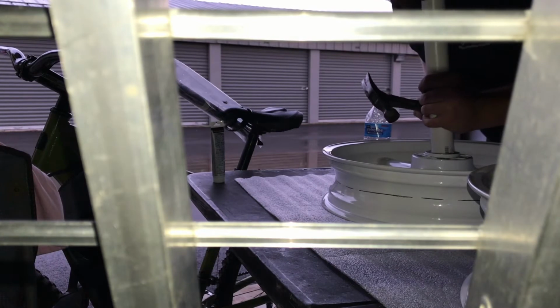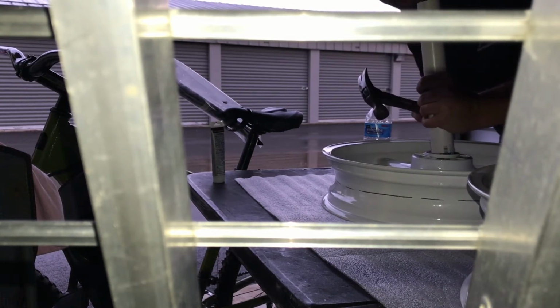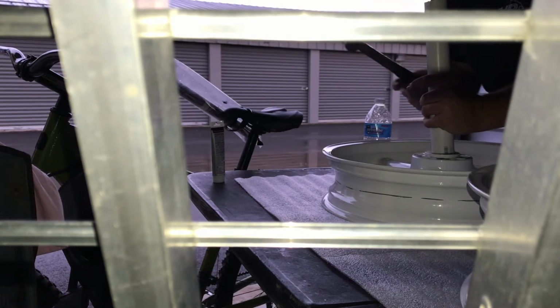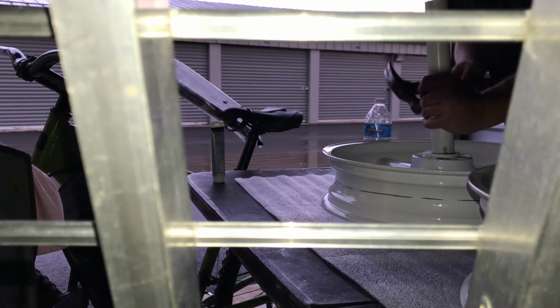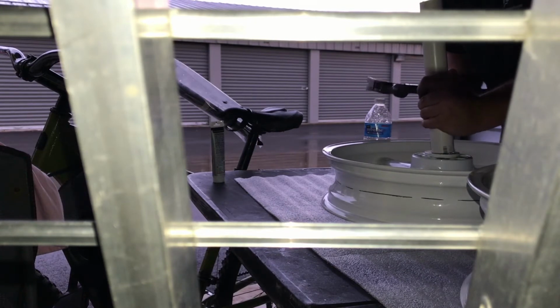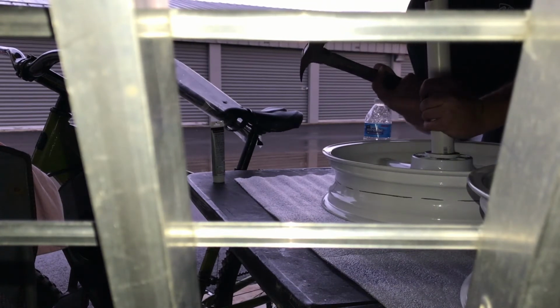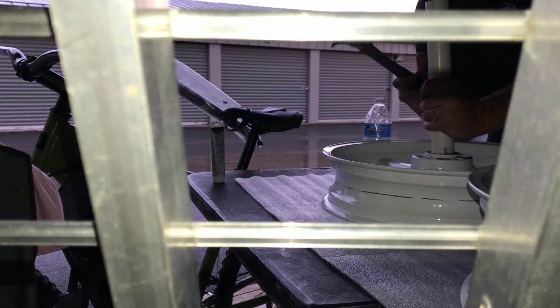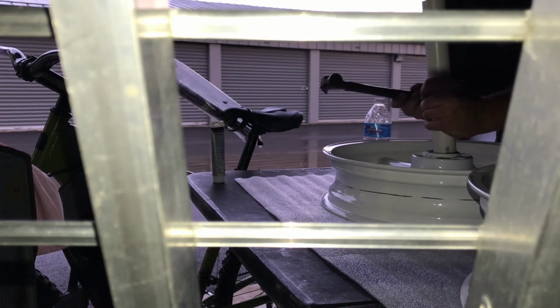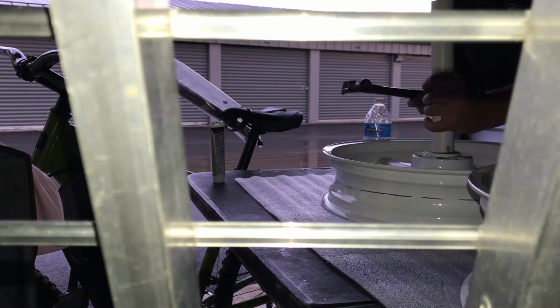If I had time ahead of time, I would usually freeze the bearings so they contract, minimal but just enough, and leave the rim out in the sun so it will expand, being aluminum. And they surprisingly go in way easier. Don't believe me? Try it. Do your bearings. I guarantee your sport bike, cruiser bearings haven't been done in a long time, or ever. Most bikes I pick up, they've never been done. So give them a try.